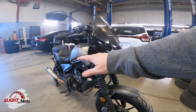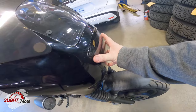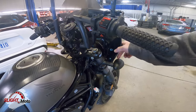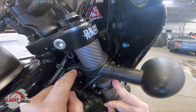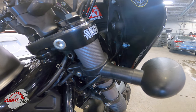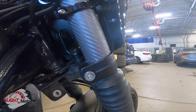I moved this down a little bit — not much — making sure everything is tight. It's part of the bike now. The mounts hold the piece that puts pressure on the headlight and the bracket itself. My recommendation is to make sure you have blue Loctite on these and on all of them. It's a better setup than I had originally — no clearance issues — and it gives you very good wind deflection. There's a little hole here where you can put a zip tie, but honestly it's pretty solid already.